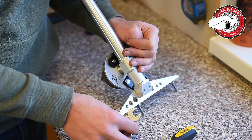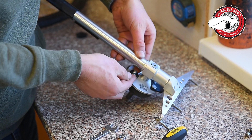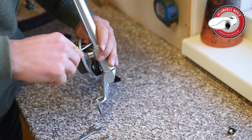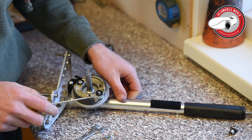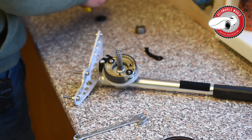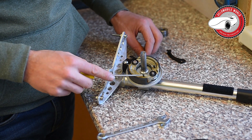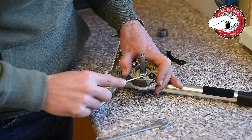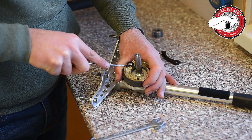As you can see there was some glue on it. If this washer is rusty, we take it off. If you need to do really big maintenance it's better to take off these two push-on washers. In the description I have the dimensions of the push-on washers we use. Never use them twice — you can see I kind of damaged it and it went flying. If you put it back it's really unsafe.